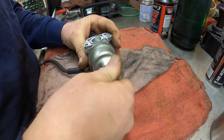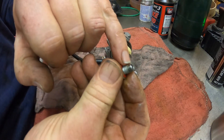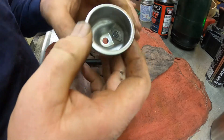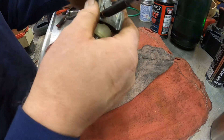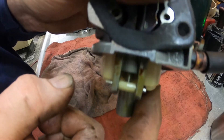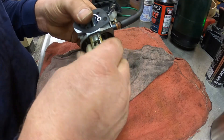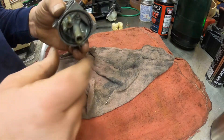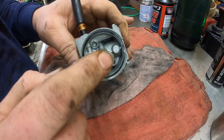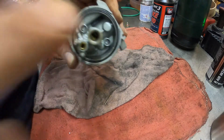I tried to get this one running really quick and it didn't run. The head of this bolt was completely nasty — I took it to the wire wheel and cleaned it up. I already cleaned the float bowl and the float. The needle and seat was stuck down — this one's got a spring and it's moving up and down like it's supposed to. But the problem is inside here the jet is clogged, and probably the emulsion tube. Let me get my special screwdriver for this.